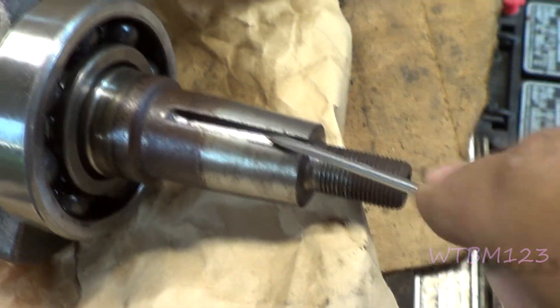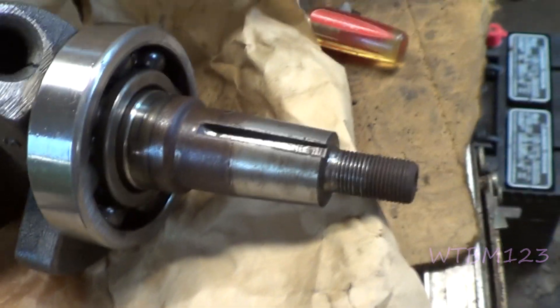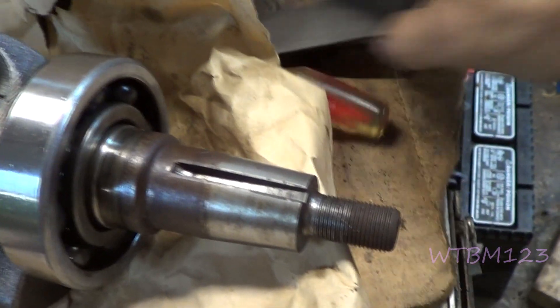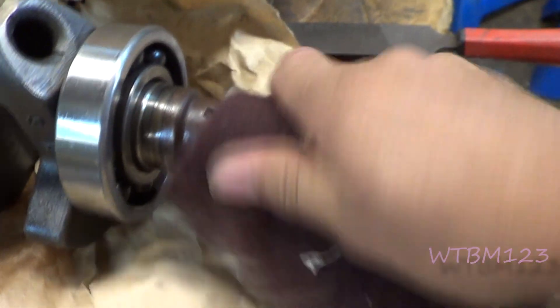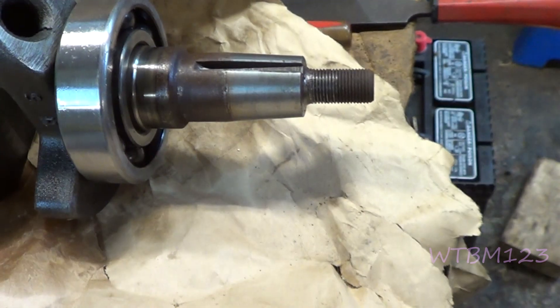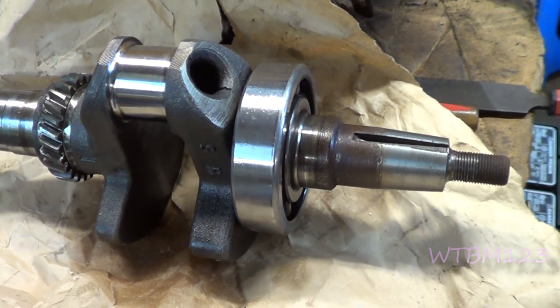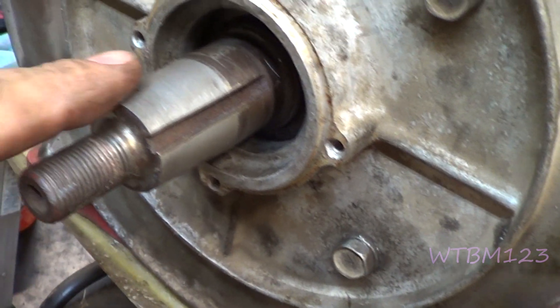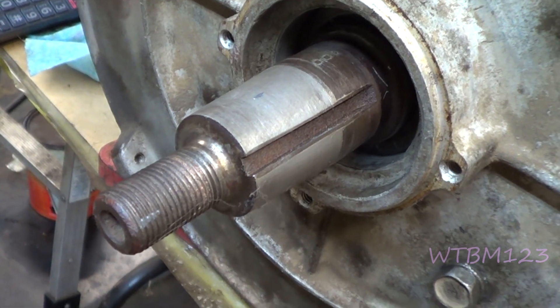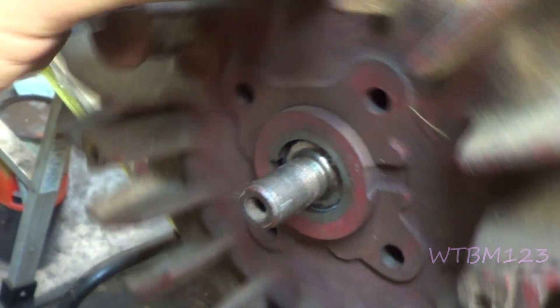Same thing on this crankshaft — get them corners down in there. Try to get as much out of there as you can. You can take scotch-brite on the outside if you need to, or some halfway fine sandpaper — don't go 80 grit or nothing. The next step I do is lap it in. When you get a crankshaft like that it's a taper fit, the flywheel goes on it. Make sure you get all the rust off and clean that keyway out really well. I take a little bit of lapping compound on the taper without the keyway, put it on there and just spin it. All I do is just spin the flywheel — go around seven or eight times and look at it.